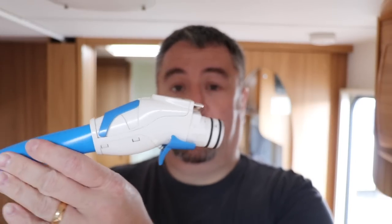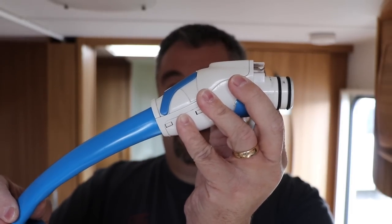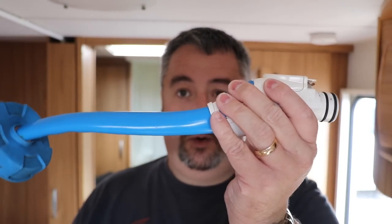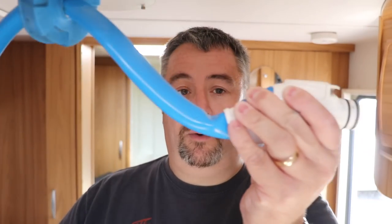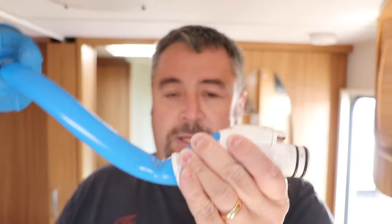Let me start off with some problems I've had with the plug that goes into the caravan. Our socket on the side of the caravan is exactly the right height for it to be just too low for a standard aqua roll when we're pitched up on a level site. As you can see, the plug goes into the side of the caravan and the hose and wiring is angled down. What actually needs to happen is this needs to go up and then into the aqua roll, and as you can see, it produces a very fine kink — and actually another problem which I'll show you in a minute.